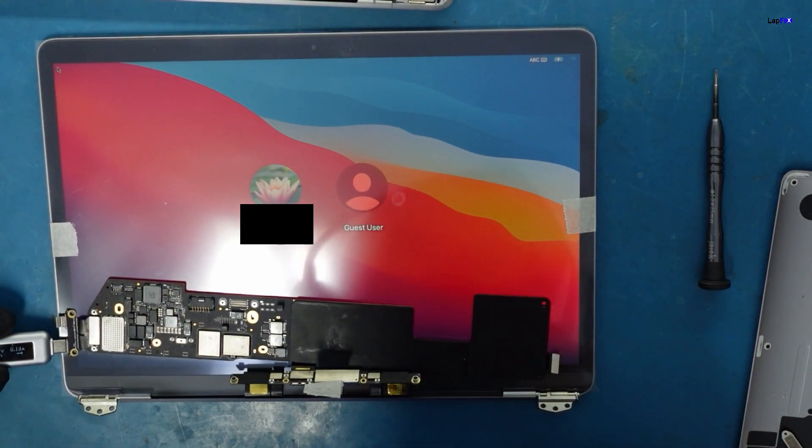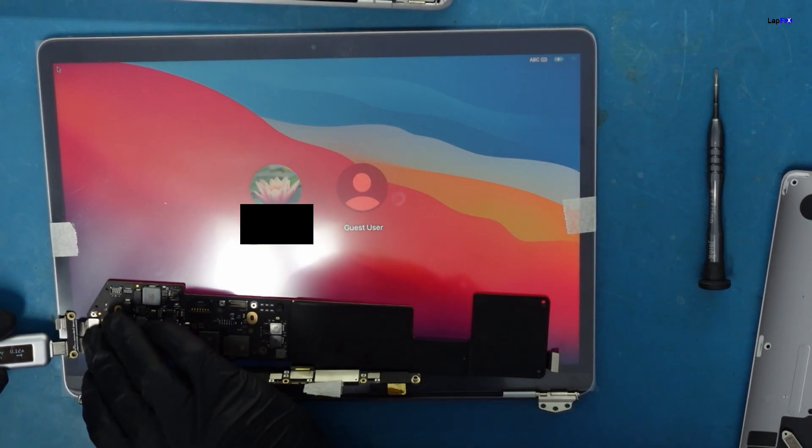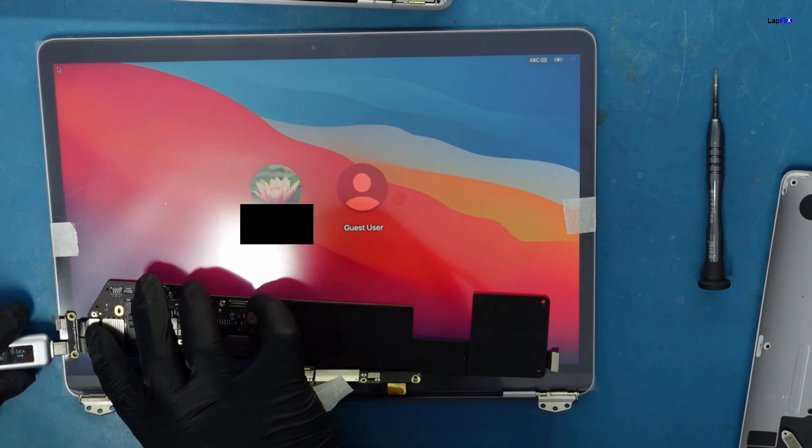I'll cover the client's name on screen. Our backlight is repaired, but we also have a confirmed bad screen on the original display. This shows how much work goes into a board-level repair — and you can still have additional issues on top. We did everything we possibly could, using schematics and replacing all necessary components around the UP700. Without a tester screen we would have been chasing our tail. Everything on the board is fixed; a screen replacement is also needed.